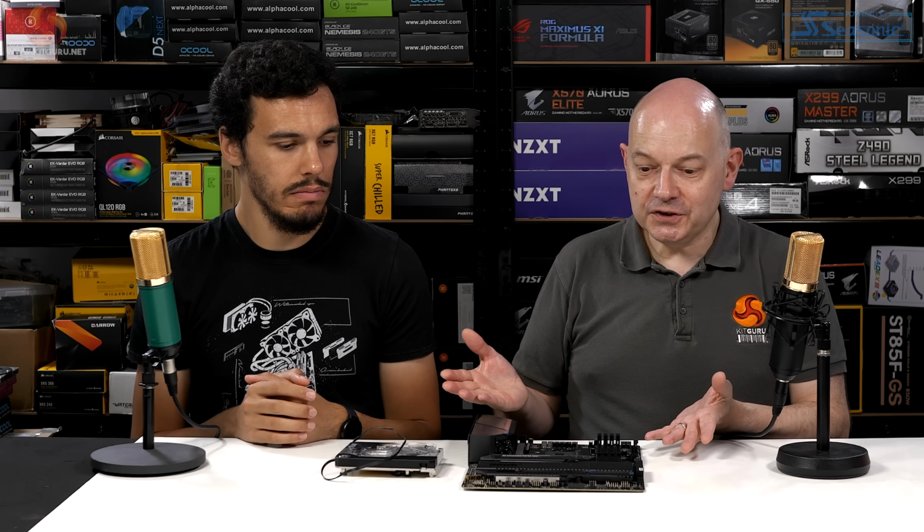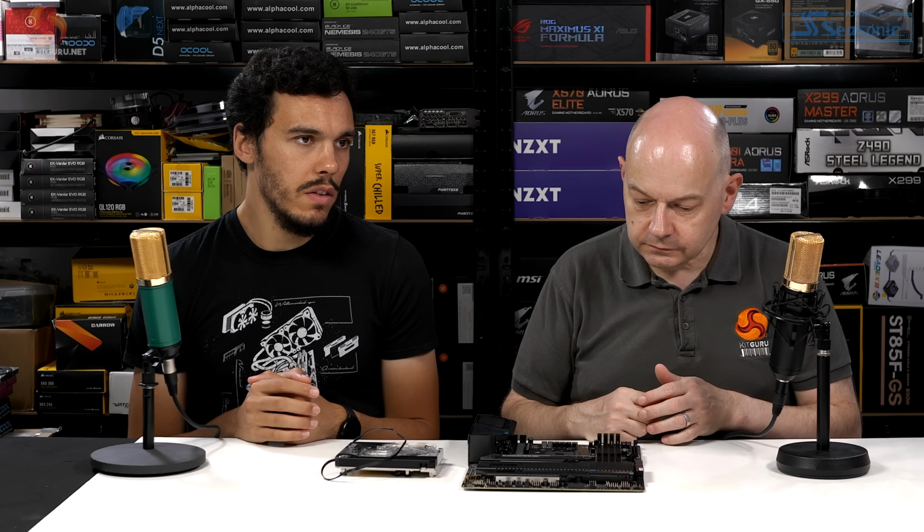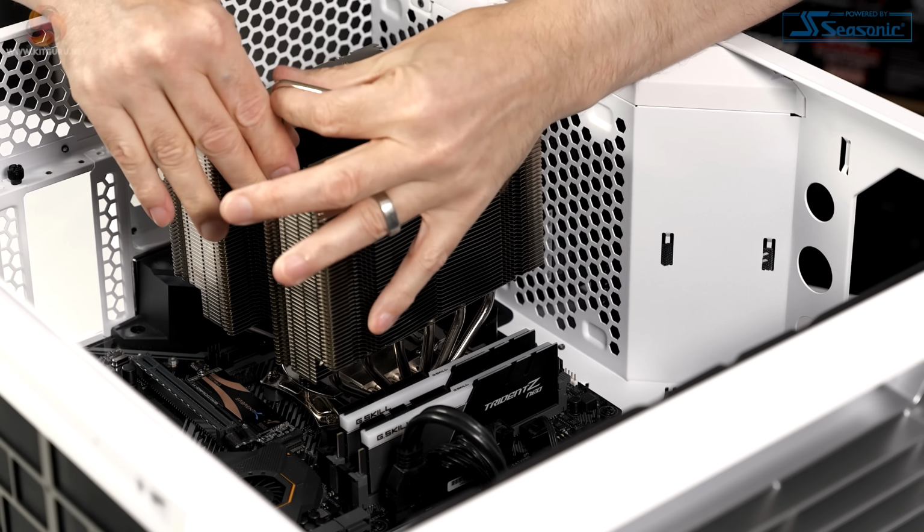But the irony of the situation is, how much liquid cooling does your AMD processor really require? Not so much. Yeah, to be fair, even so, we use the 16 core, the 5950X, which is the biggest, baddest one for the mainstream AMD processors. And as far as temperatures go, it's not the highest temperature one because it is this weird situation where the lower core count ones, higher thermal density, run a bit hotter. Luke sent me the 12 core to use in some of the builds I've done. I see that fella pulling 142 watts package and typically 80 Celsius, but with a Noctua on it, it was running at 70.